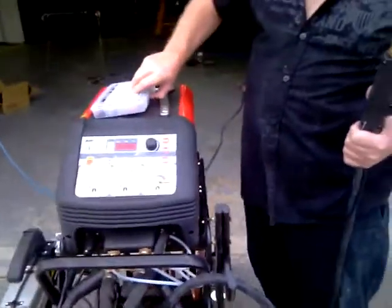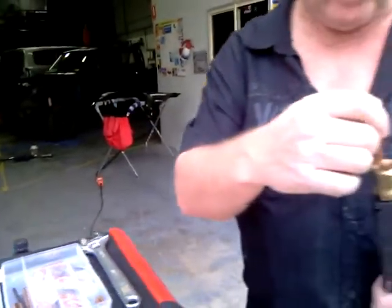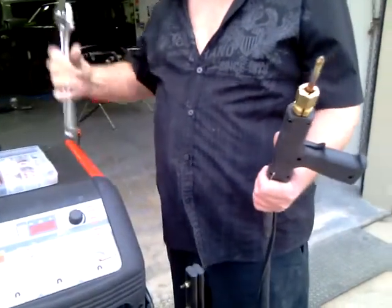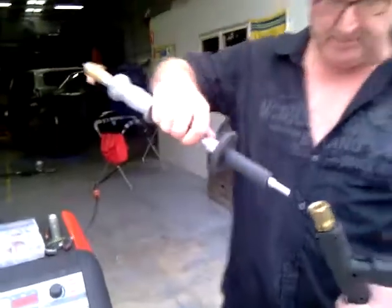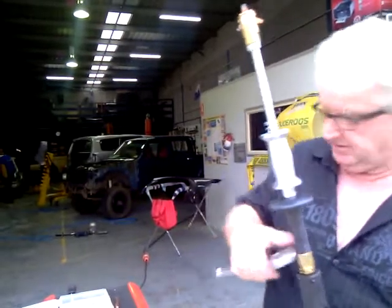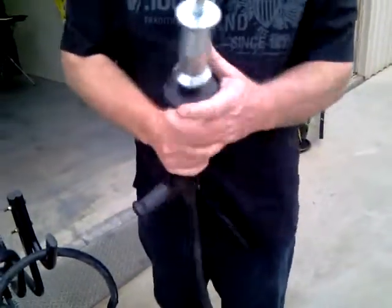This is single side. It comes with a range of attachments — one for wiggly wire, one for single side spot weld. It's as simple as putting the end of the nozzle in and doing it up with a shifter spanner, then do a single side weld. It also comes with a slide hemmer dent system — same thing, pop it straight in the end, move it up with a shifter spanner. You now have a single side dent system that welds to the panel. Pull the trigger — that will weld to the panel and along you go. Very, very easy to use.